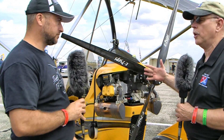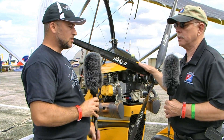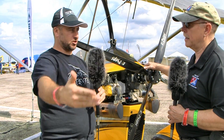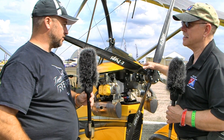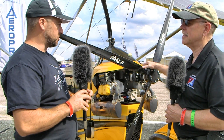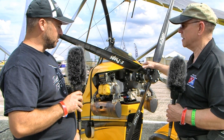We're seeing a four-blade prop here, still with the Rotax engine. In cruise at 80 miles per hour, we actually dropped one gallon per hour on the 912 iS — that's pretty significant. We flew it all the way to Oshkosh; that was its first big cross-country out of the small circuit during testing, and it was really easy to tell that we have a huge efficiency gain with this particular propeller.